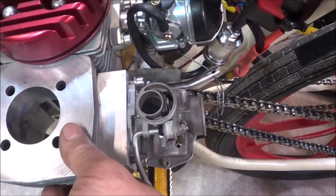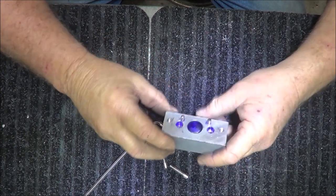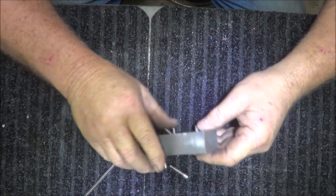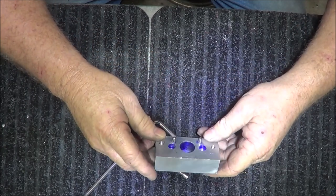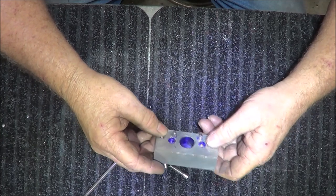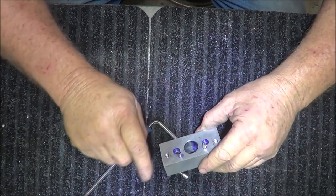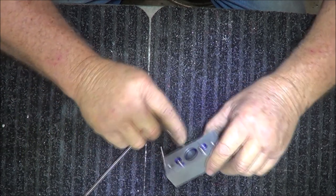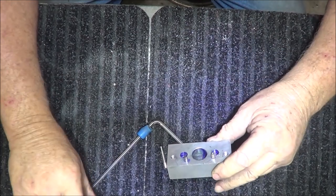I'm probably going to scallop some of these corners on the mill maybe a little bit, because I got the outline of the carburetor on there good, and I could chuck this like that and then just knock this off and then knock this off, and I could probably come some more right here and cut this off. So I don't know, I'll probably lighten it up some, because all the bolts are in line with this. And I was hoping that the bolts in this one would be high enough and wide enough out of the way where I could put another bolt right there, but that didn't happen. So getting to these are different areas, because you can get to this side pretty easy, but this side over here, you got everything in the way. So that's kind of the way it is.